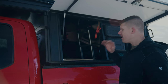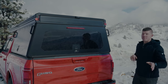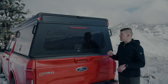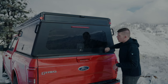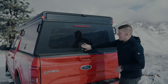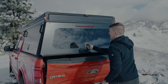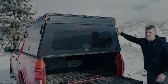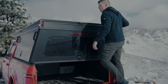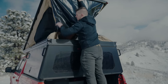Before we open it up, let's talk about the rear window. This window and the cab window both come standard, as does a rear brake light. We have a weather strip along here that seals against your tailgate — a single latch opens it up. I'm going to open it up and drop my tailgate. This is where the rear grab handles come in handy; they help you pull yourself onto the camper. To open it up, you pop two latches and the gas struts do the rest.